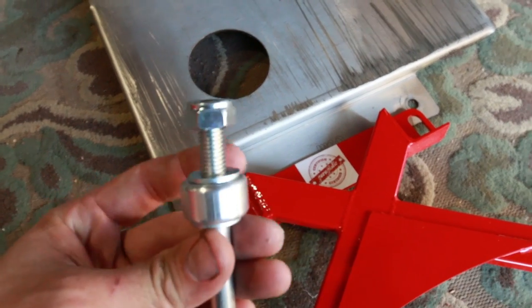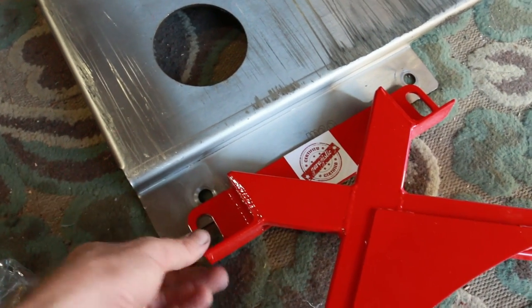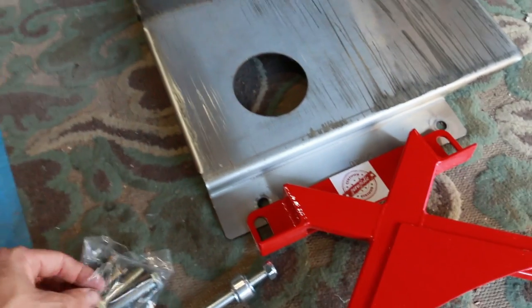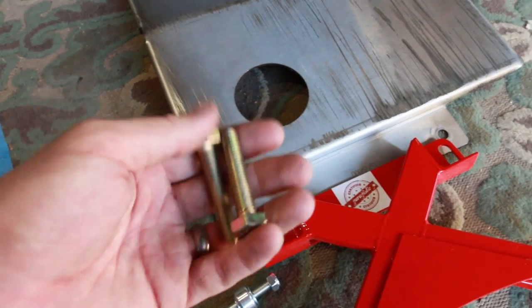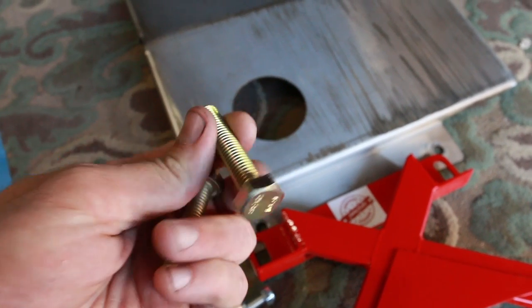Got this — it has some spacers. You may or may not need to use the spacer. If you do use the spacer, it's going to go right in between the subframe just to clear some aftermarket sway bars. And then this is going to bolt up right where your lollipops go. We're going to use this new nice zinc-coated hardware.